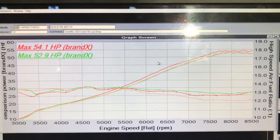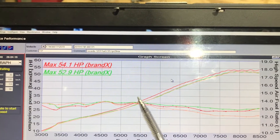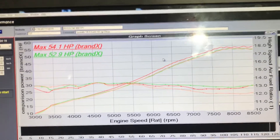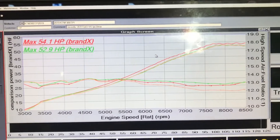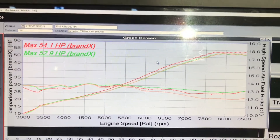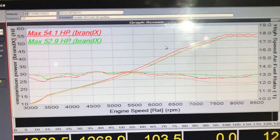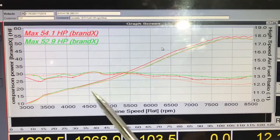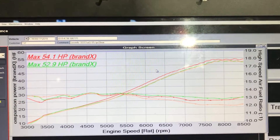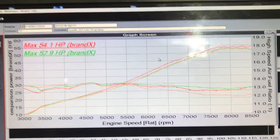There's still more work to be done, but so far I'm making really good progress. I'll probably try one more tune using our high comp head, with the aim of getting even more power through the lower mid-range while keeping it nice and safe. Hopefully pretty soon I'll be able to offer at least two or three different setups — a different compression ratio head matched to a different tune in the stock ECU. We'll offer exchange ECUs. The next step is to do a whole heap of track testing, to make sure what we're seeing on the dyno relates to different styles of riding, and hopefully offer TPI owners new and effective tuning options without spending a fortune.